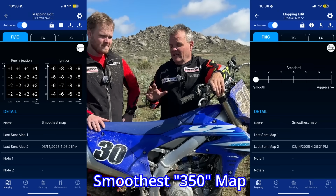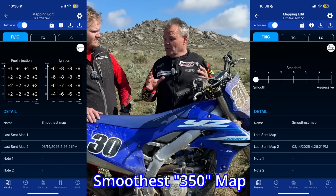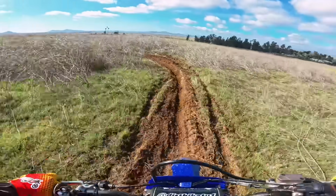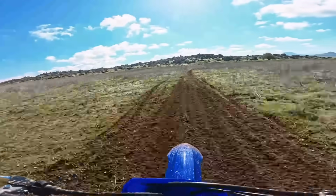I will say playing with it is actually pretty fun. I always kind of joked around with it because the older one wasn't as usable, so this one's pretty fun to tune with. I think where it's going to become a bigger issue is when you switch mufflers, because that's going to change the tuning a lot. Exactly. You get that popping and farting. And we hear guys at the track mention that, so we'll want to try to fix it. We will do that in a new video when we put an FMF on. If it pops, we'll show what map to use and figure out how to fix that. Yes, exactly. We'll be showing that in the future.